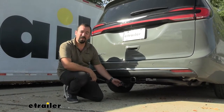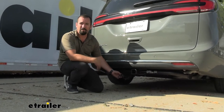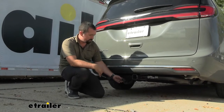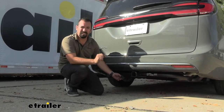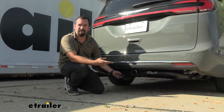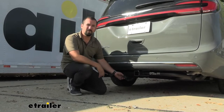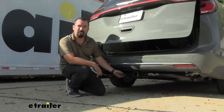You are going to have to run a power wire up to the front to get that 12-volt power supply, but that's not too terribly bad — it comes with all the butt connectors to do that and it's minimal. This is going to give you not only your running lights and turn signals, but also your brake lights, letting the people behind you know what you intend to do, keeping you safe and legal.